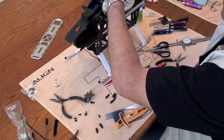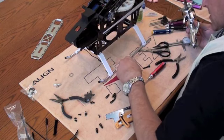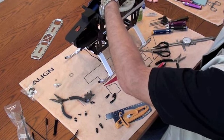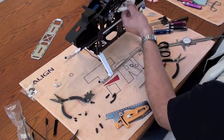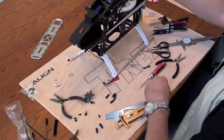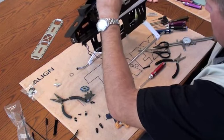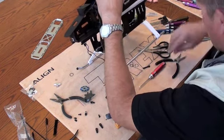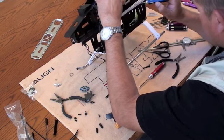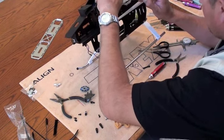take the main shaft out, get that shim, put aside the thick one, and then let's go to the next thickest one. Let's go to a little bit thinner. And then we'll check that one and make sure that that shim is what we need. Same thing again, we want to go in here, make sure that we're lining up. Appears that we are.